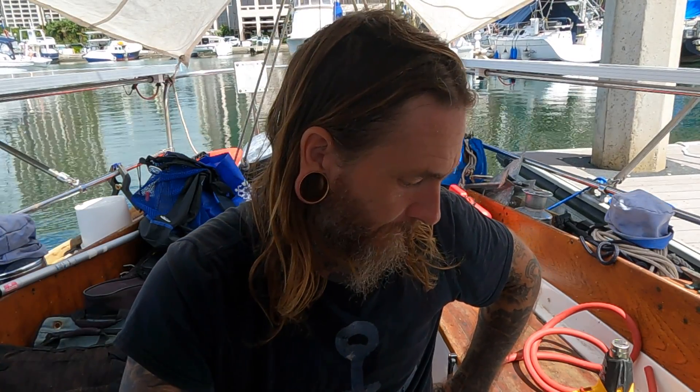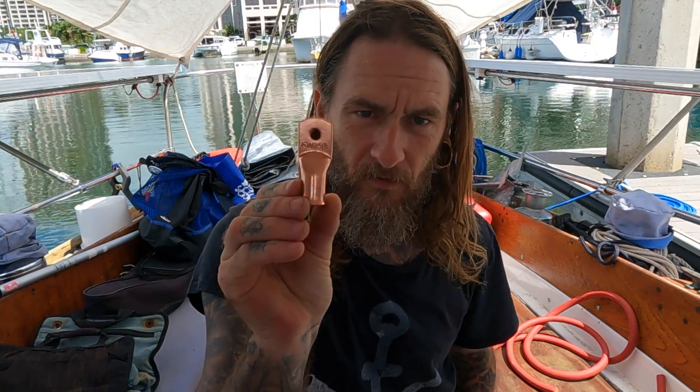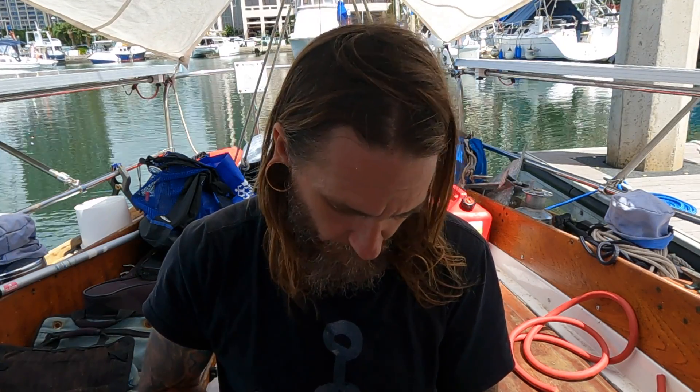Now it's time to make custom battery cables, which I'm very excited about. I've already made one - this is like monster 4/0 wire, huge. It's much cheaper and makes a lot more sense to just buy a bunch of cable, cut it to the lengths you want, and then crimp these lugs with this hydraulic crimper. We're about to do that. This is a little six-inch shorty cable with a 3/8-inch lug on one end and a 5/16 on the other because of the different fittings where it's going to go. I went and made all my measurements and a full list of everything I need.